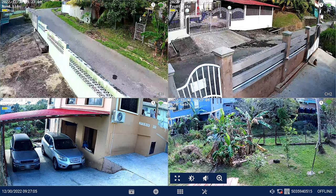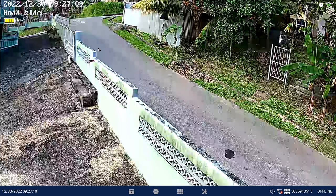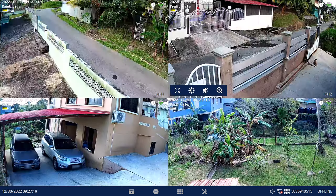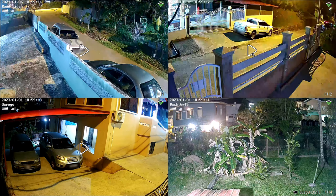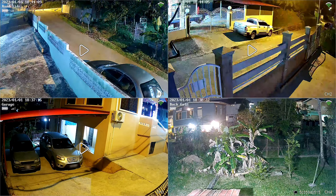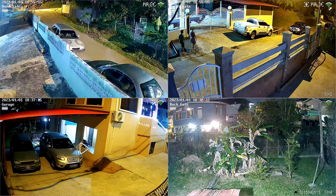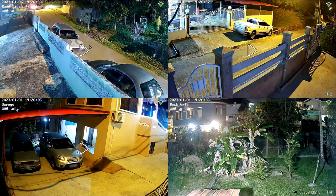Once you have connected all your cameras, you need to understand how the camera system works. Unlike conventional wired or wireless cameras that provide a continuous stream of surveillance, this system provides two options: a live mode of continuous surveillance, and an event recording mode using an intelligent detection system. Due to its built-in rechargeable battery, it's impossible to sustain a live stream and charge its batteries via solar power at the same time, especially at night. So in order to conserve battery, they implemented an event-only recording mode that only records when something occurs within the field of the motion sensor. This allows the camera to monitor your premises all night without depleting battery life, and to fully charge within just three hours of continuous sunlight. The disadvantage is that you cannot monitor a live continuous feed the way you would with conventional cameras.